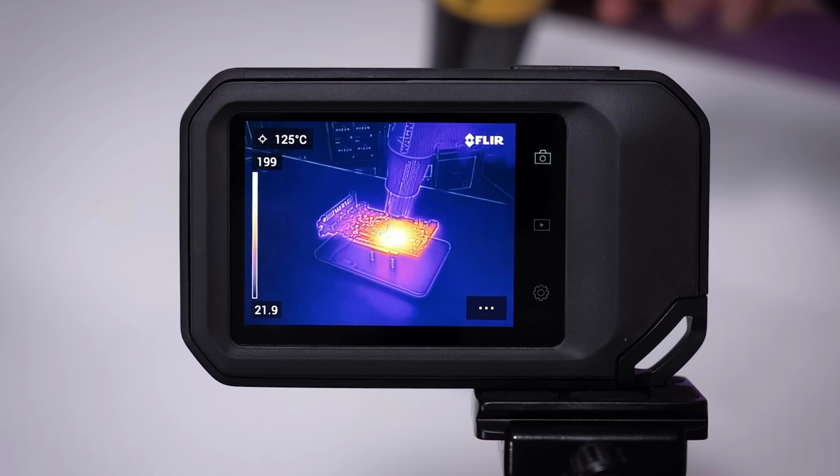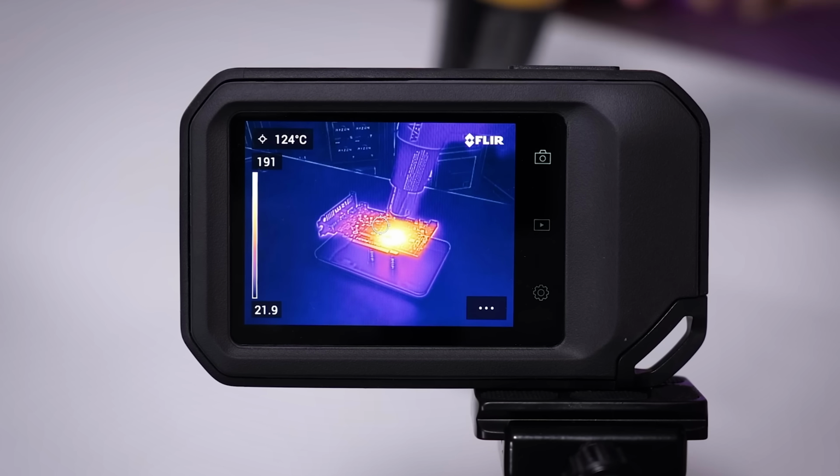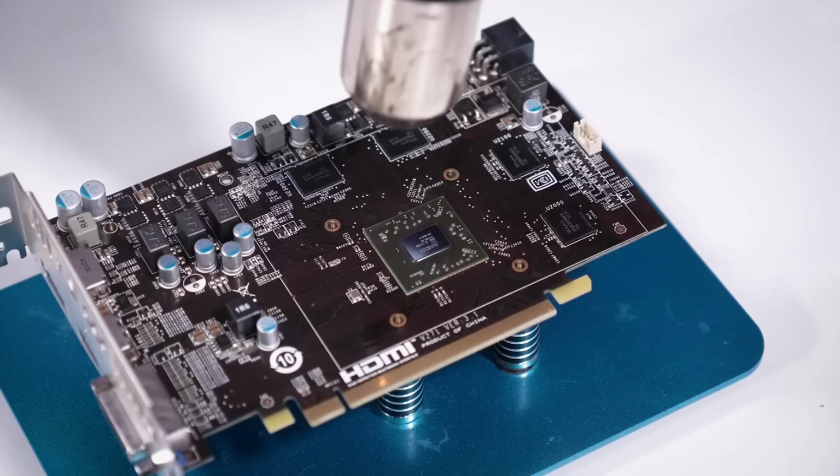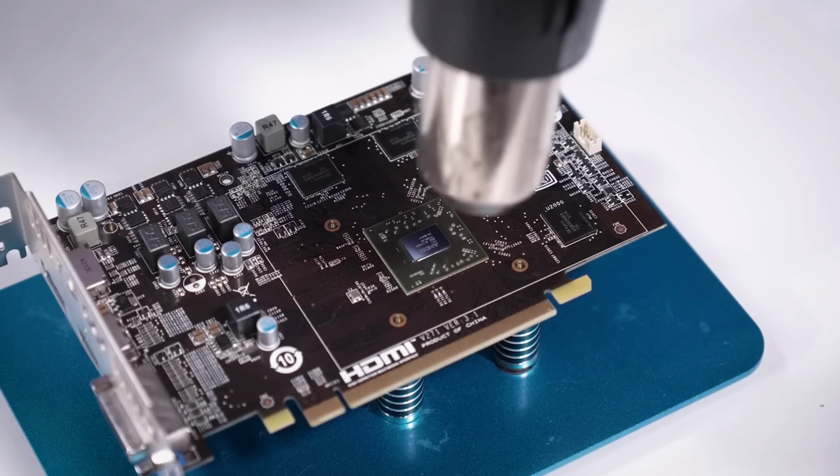So we've just got a card that I can't fix here without maybe blasting it with heat, which I don't want to do because long-term, that's not really a solution, especially for a viewer. I want them to be up and running without issue. You know, the oven method, the bake method. Now I have actually seen it work before. We've even fixed cards temporarily before, but they never really seem to last. It's just not a chance I want to take with a viewer's rig.